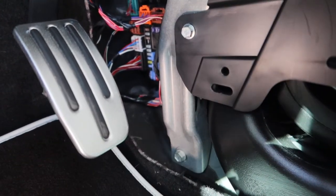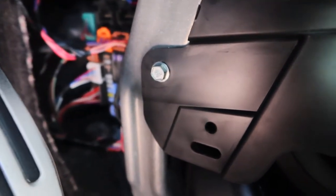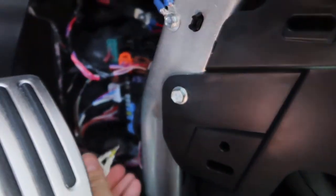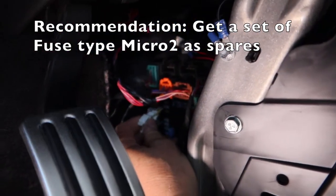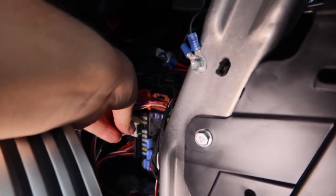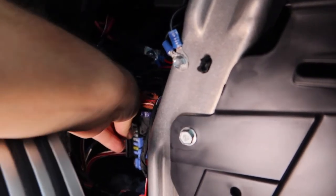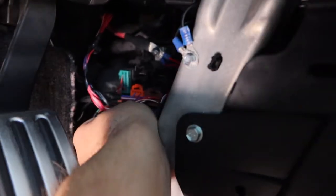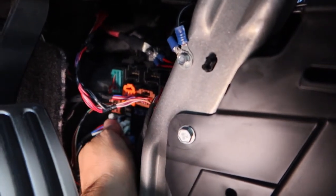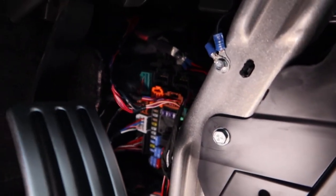It's a very tiny fuse. We need a little more light. Squeeze the new micro 2 fuse into the fuse puller, then insert it on spot number four on the left side. Jiggle it in, then take the fuse clamp out and don't forget to place it back before you close up, so you always have it with you.